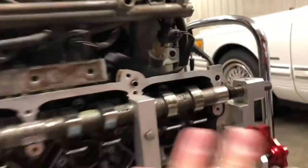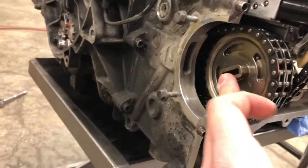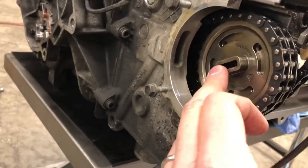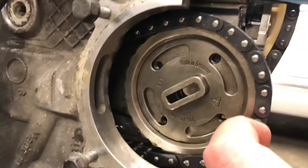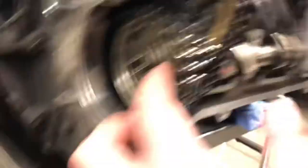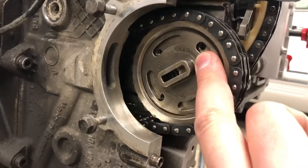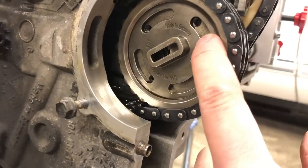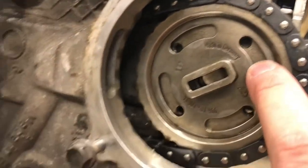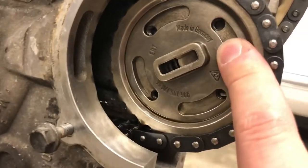Everything is good. In the meantime, the cams will not move — they're locked in by the special tool and are not connected to the oil return pump drive plate. As the manual calls it, this is actually the oil return pump drive plate. The center part here is what actually drives the oil return pump. The bolt holes for the bolts that fasten the oil return plate to the exhaust cam are very far over in this slot because we're in the U6 orientation. Once we rotate the engine, these will get more central — you can see where the old bolt marks are.